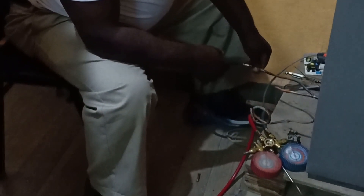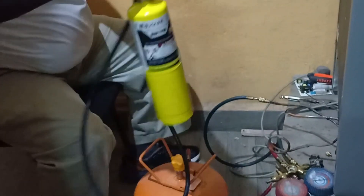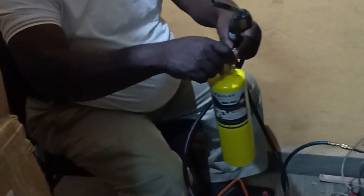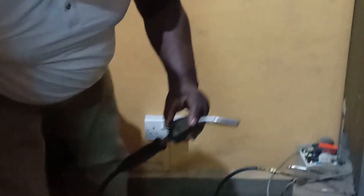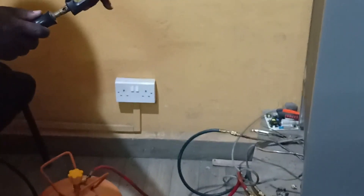Then I'll use my gauge manifold to insert Freon R600. Because the gas is very flammable, I'll use the torch method to detect the area of leakage. This is R600 that will enable me to know the area of leakage. I want to use a small flame from the torch to the capillary section, because the gas should enter from the cylinder via the gauge to the junction and come up to the capillary. Being flammable, I have to take extra caution, otherwise the whole system will burn.